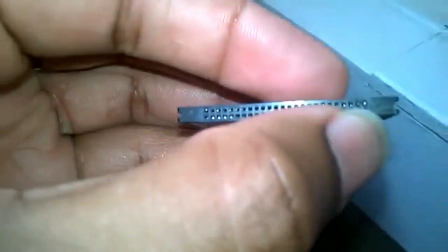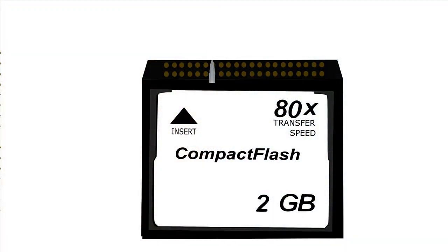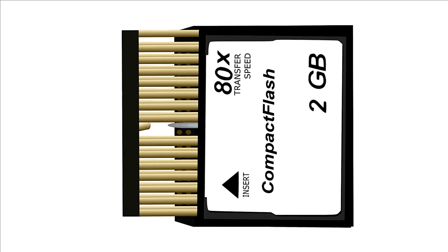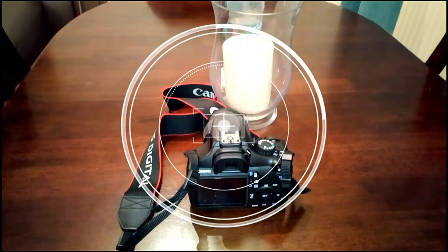What you need to do is cut a small piece of the wire, take your CF card, and insert that wire inside the card slot, leaving a little bit sticking out — as you can see here. Now take your flash card and insert it inside your camera. You can see that the pins are now making contact with the card. You have solved the problem within three minutes — the problem is sorted.